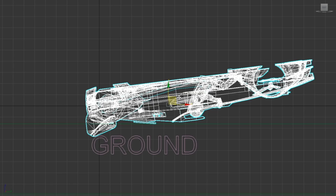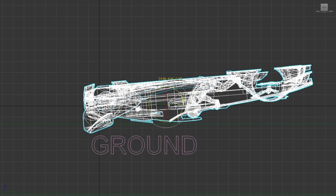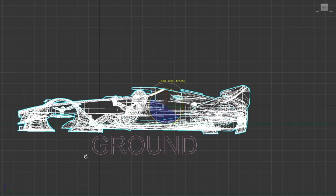Let me show what happens in a rollover. With the green part as the ground and rolling the car over at a bad angle, my head is barely pushed down — not too bad. It rests on the front and the roll cage point. Now that shouldn't happen because the engine and trans are in the back, the heavy part of the vehicle. I'm going to build the spoiler as a crumple point, so it should always outweigh the front and push the vehicle down to a better resting angle, giving me room to climb out. Safety first.